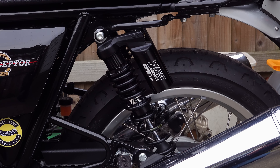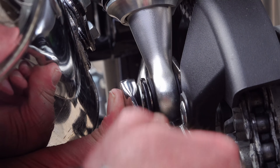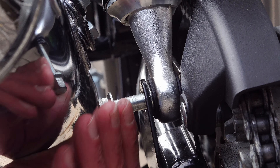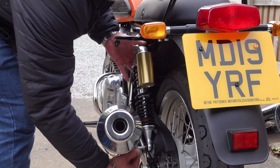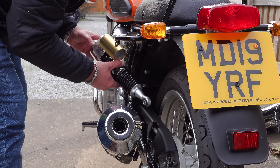The build quality is absolutely superb. I personally love the Black Edition, but if you want something more conventional they also have a standard silver and black version. Fitting is really simple. I would advise changing one shock at a time — don't remove both, it'll be a nightmare to refit. Start by removing the mounting bolt from the top, then with a 14mm spanner remove the shock pin from the bottom. It fastens into a captive nut, so just remove the bolt itself, then jiggle the shock absorber and carefully manipulate it out.